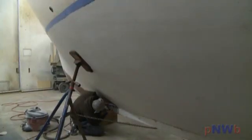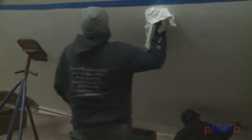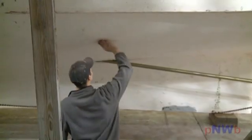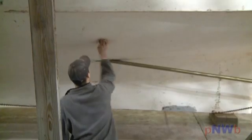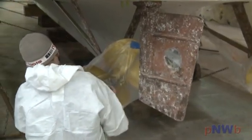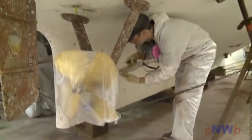The next step is to abrade the hull with 80 to 120 grit sandpaper. Wipe the hull down — isopropyl alcohol works real well — ensuring there is no leftover dust. If you rinse with fresh water, make sure the hull fully dries out. Under no circumstances should you clean the hull with any oil-based products or solvents like acetone.